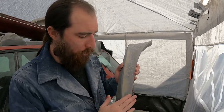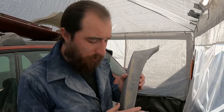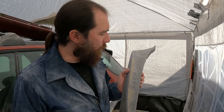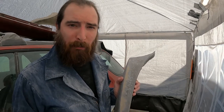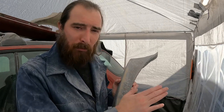We're also going to expand the top half. Since this goes into the door jamb, we're going to fiberglass and extend it. There's actually a step in between — I have done this once already but lost the footage, so I'm redoing it. I didn't like the way it turned out so we're going to do it better. We're going to take bondo glass and fill this back in, get it nice and smooth, and that'll build us a nice level transition from the body kit to the door.